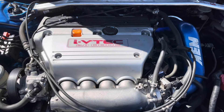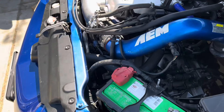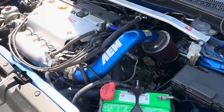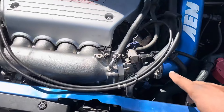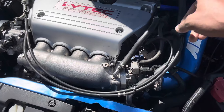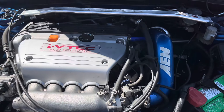The oil pump is still factory. We have an AEM intake for now — we tried to use the Mugen box but it wasn't working. We still have stock factory exhaust; we did try to put Type R headers on here but they didn't work — the fitment was sitting too high. As far as the throttle body, the base model won't work because the adapter hits on the opposite side, so we went to the Type S throttle body and use the Type S throttle cable bracket with cables.